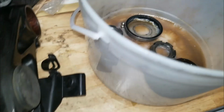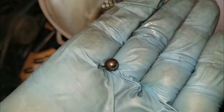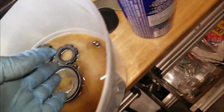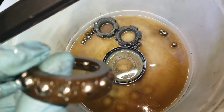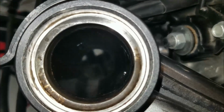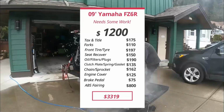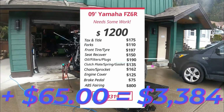No! Removal and investigation has revealed the ball bearings had corroded into a flat spot and now restrict movement in the cage. The ball bearings had lots of grease on them, but after sitting for a few years, moisture worked its way into one side of the stem, with corrosion as the result. Fortunately, this is not that expensive, another $50 in bearings and $15 for the used brake light switch.